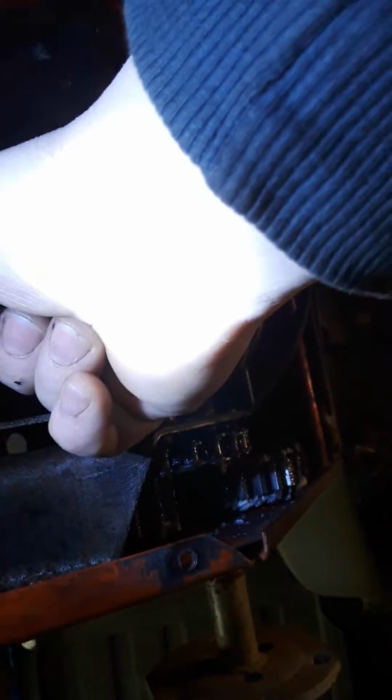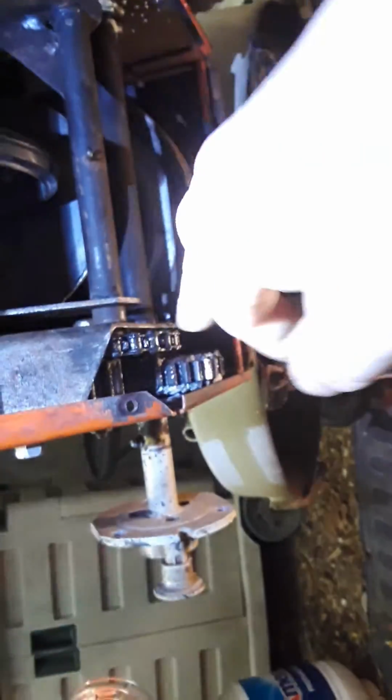All right, from there, you slide this whole hex shaft back in and work it through this hole and that one. All right, and then you tighten up the nut that's at the end of this using this service port, okay? Then you tighten these nuts back up. There's 4 of them for that bearing, and you have to actually position this inner piece of metal. You have to hold it when you're sliding this whole thing through, so this goes in, okay? Tighten that up.